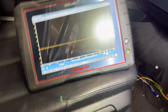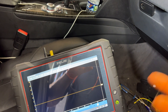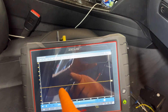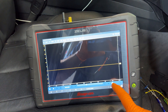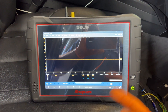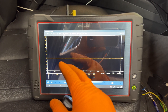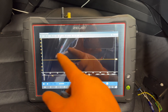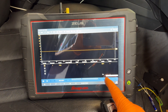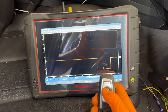The way I set up the scope - there are two wires because one is ground and the other is power one way when you're doing a lock, and when it's unlock it's going to be the opposite polarity. So we'll see one going down and then another going up. For settings I got it on 50 volts so I can see more of the waveform. I put 5 seconds per division. All right, I'm going to press the remote - that's lock and unlock.